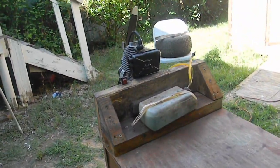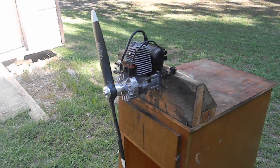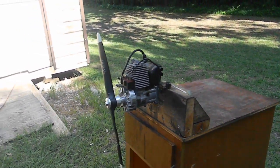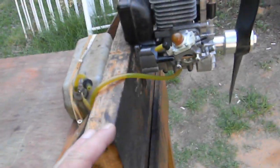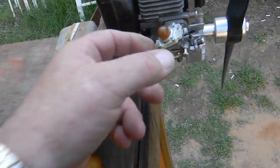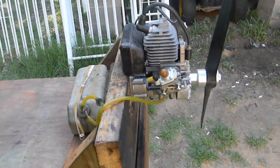I ran probably 15 ounces of fuel through it and just had a lot of fun with it. I've got to do a little modification to the muffler and it will be ready to go. It's got a cup mount on it. When I took it off and looked at it, the piston and the cylinder looked smooth — hadn't been run much. A lot of power here. I'm going to put a carburetor bell crank on it, mounted right here to the cup mount. So it will be an easy shot to hook up the throttle, do the modification to the muffler, and be ready to fly a big old model airplane with this thing.